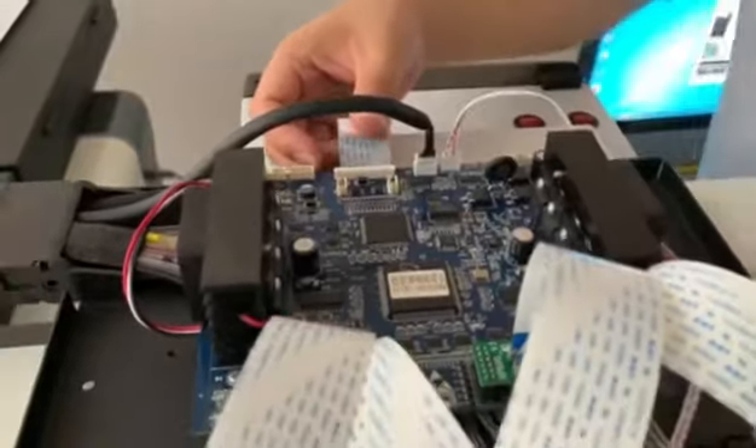In that case, if there are still no lights working here, it means the print head board must have a problem. About 90% of the time the problem is the print head board, and about 10% of the time it is the main board. This is the first situation.